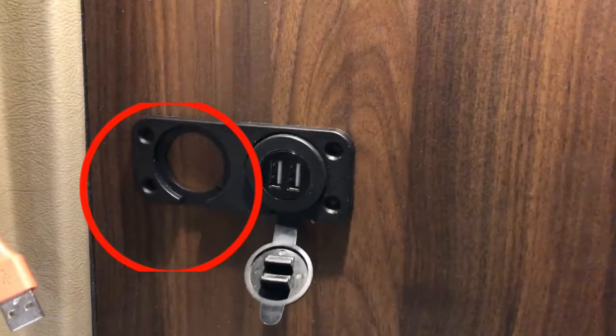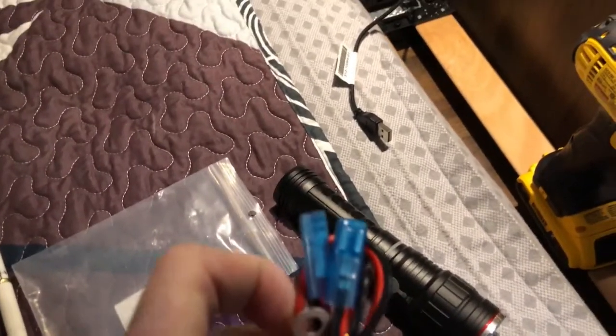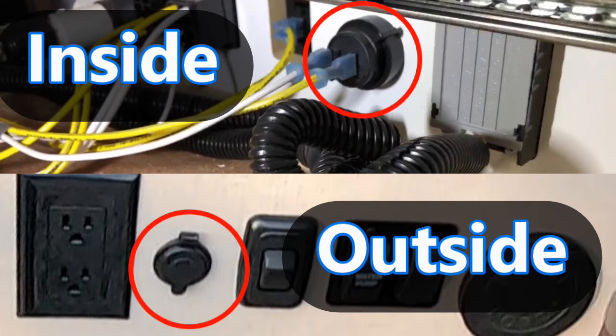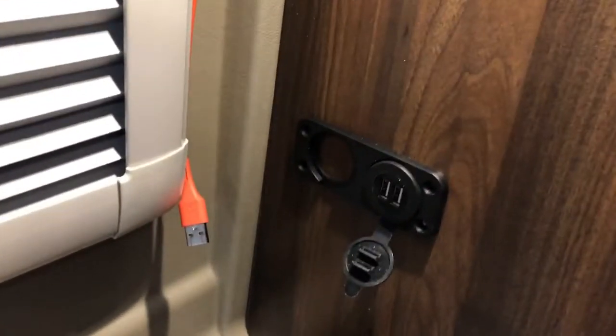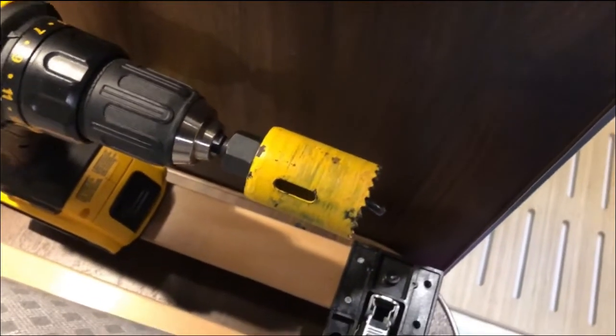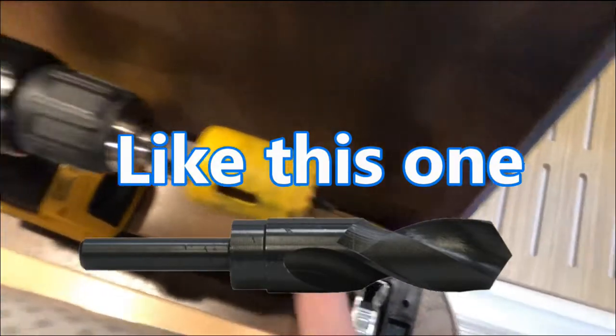It's still not going to be real easy. Just in case it's not obvious, you will have to drill a hole. I'm choosing to drill over here on this side, and I did go into the cavity and checked to make sure there was enough room for the wires — remember, the wires have connectors on them. I marked it and drilled it using a hole saw; this is one and a half inch. If I had a regular twist bit I would use that, as it'd be a lot easier to hit center, but we're going with what we've got.